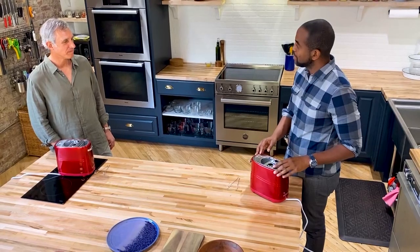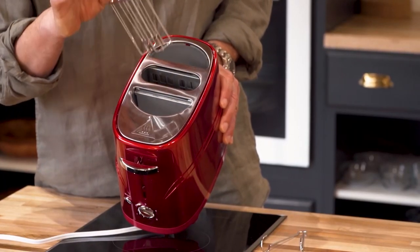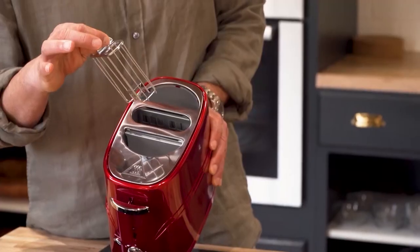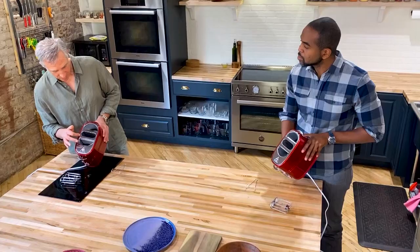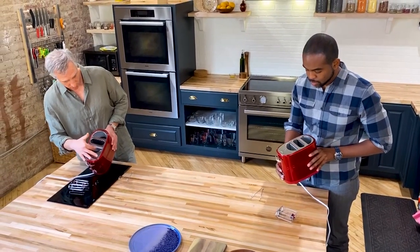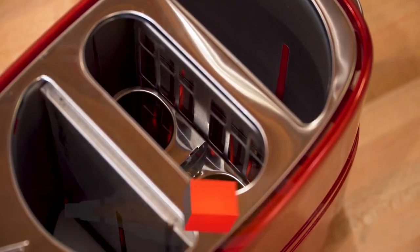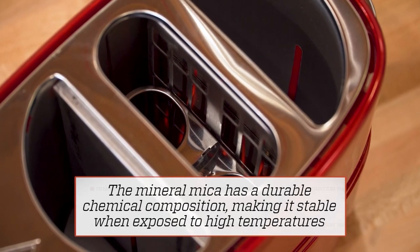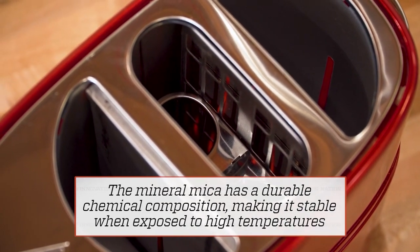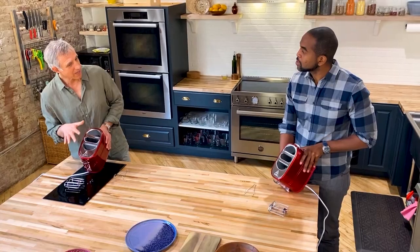What are the different elements that make up the hot dog toaster? Inside is aluminum and your heating elements. This is your hot dog cage, designed to fit regular-sized hot dogs and larger plump hot dogs. Inside there is an aluminum plate on each side, and between that and the heating element is a mica plate. The mica plate prevents the bun from overcooking so it gets lightly toasted. Those are your main elements that make the pop-up hot dog toaster work — and the mica plate is the key.